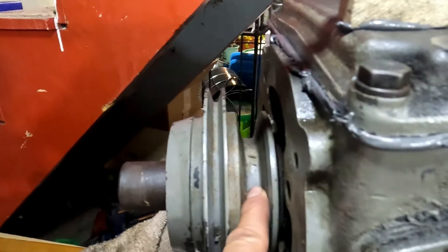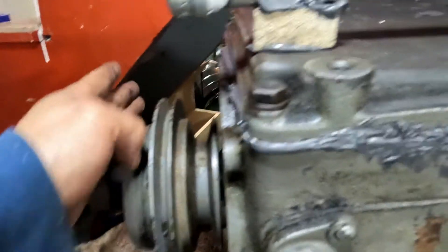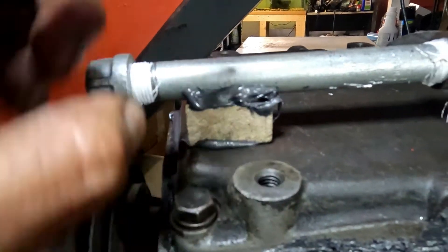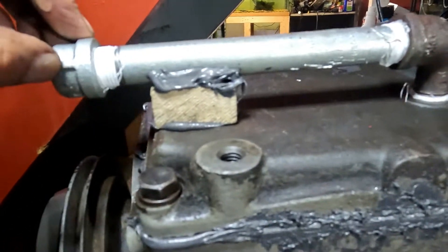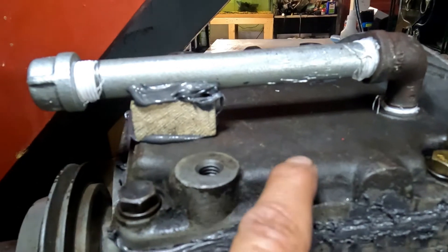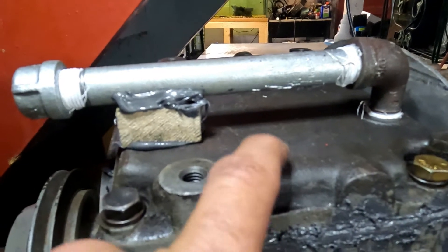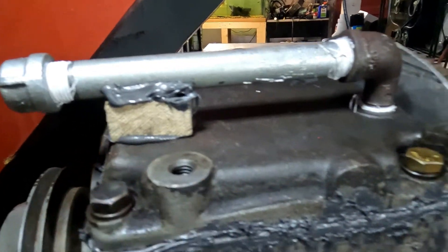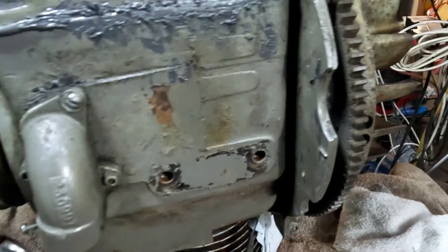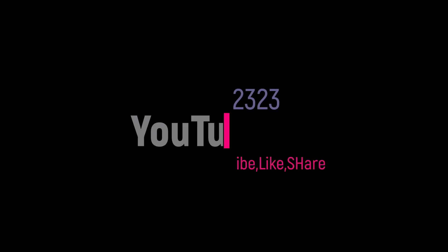This isn't the original one for this 10-horsepower Kohler, and the belt goes the other way — the PTO is further out this way. So it's not in the way of the PTO belt. I put a little piece of wood in there so the gasket is going to get hard with no weight, no pressure, no tension on it. Wood won't catch fire until over 300 degrees, and this engine gets about 240 to 250 degrees inside the oil, so that should be okay. Now I've got to set it and forget it. I'll probably put the starter on it right now since I have time.